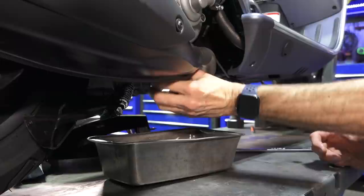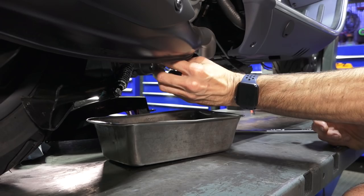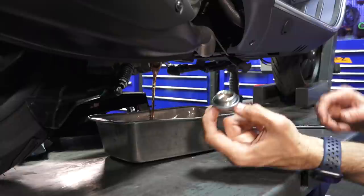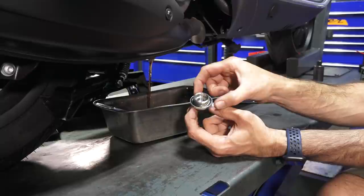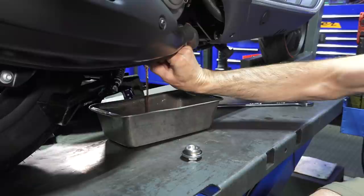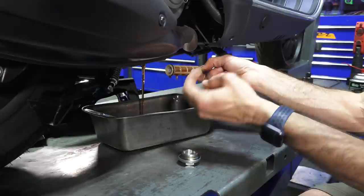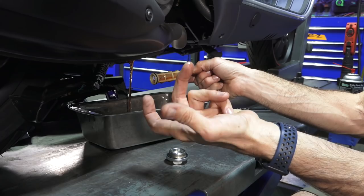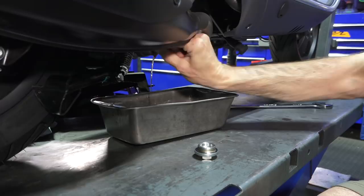Have your oil pan ready — I'm just using a bread tin, but we also have a scooter oil drain pan with a part number in the description. Go ahead and pull the oil drain off. Being a new scooter the oil is pretty clean and new. You can see the o-ring in there. If you're doing the first service I'd certainly replace it. You can also see the oil strainer, and even on a brand new bike that's only been run for five miles you'll already find some little particles — that's probably grease from assembling the motor, not unusual at all. Let it drain and we'll put the scooter up on the center stand.